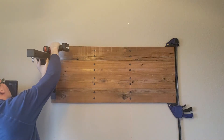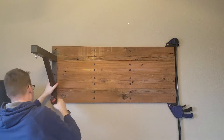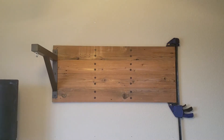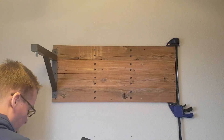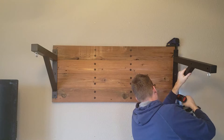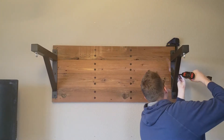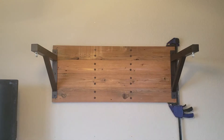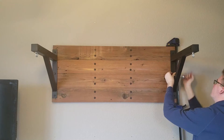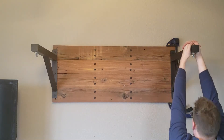Hanging the first bar — here's where I realized that the gun isn't actually going to fit in there. More lost footage, but you'll see how it works on the other side. I wound up using a socket wrench to get the one in the middle. I only realized well after I finished the project that I did actually have a 3/8 universal joint that I could have thrown on there to make things go a little faster and easier, but just using a socket wrench worked well enough. I wound up finishing it off with a ratchet, which is good because it gives you that hand feel of how tight it is. The bar is quite solid, so I'm happy with how it worked out.